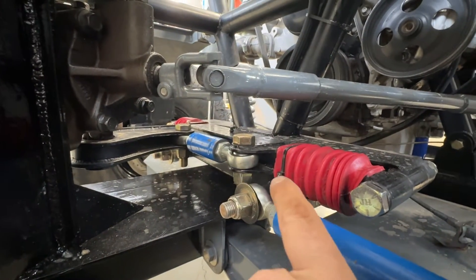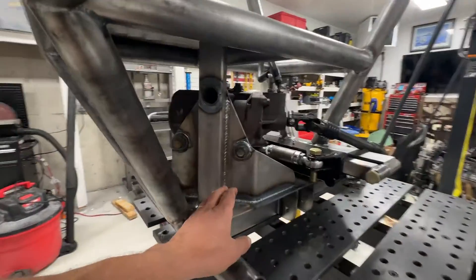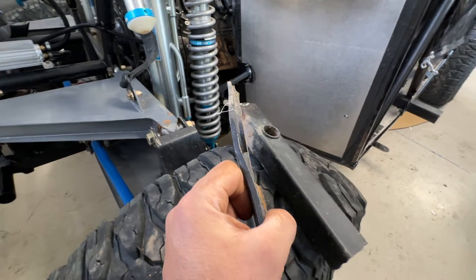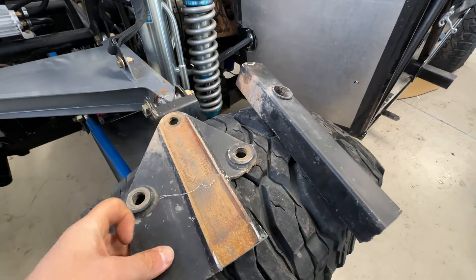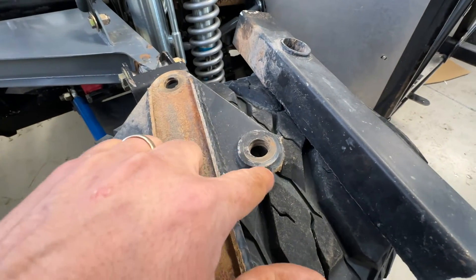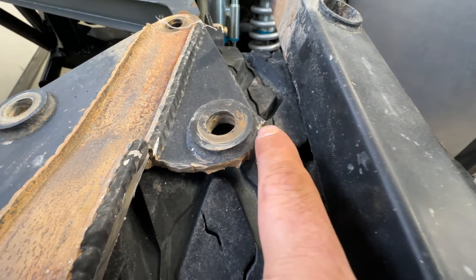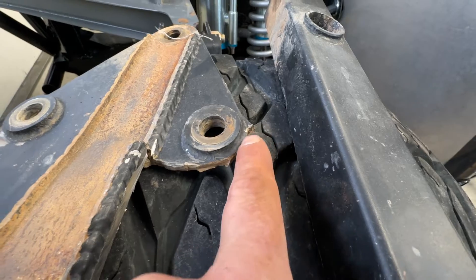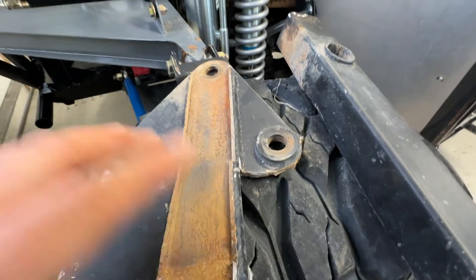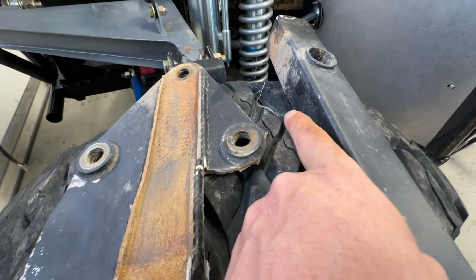Now, what did fail? This thing was transmitting such a large load through the Pittman arm that it made the mount for the steering box fail. Here is the old mount — quarter-inch plate steel. You can kind of see some of the bends and some of the failures that happened here. I also had quarter-inch washers, which I was hoping would double up those holes, but what I ended up doing was creating stress concentrations too close to the edge. It allowed cracks to start and propagate across — you can see that crack continued all the way across the back of the quarter-inch plate.